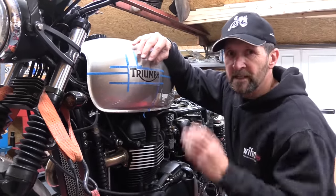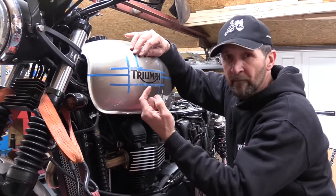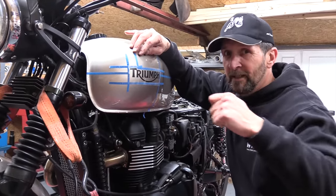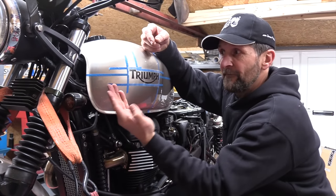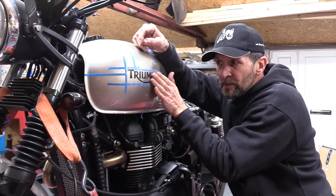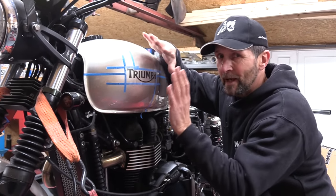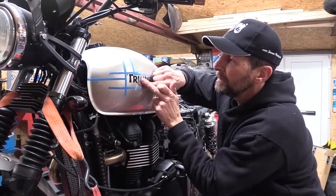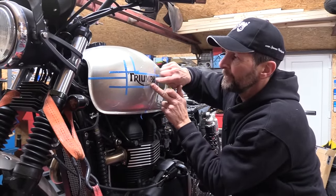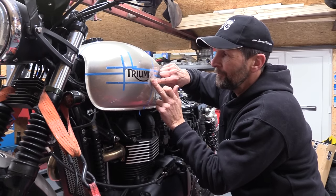Okay, at this point, an easy mistake to make is to take that cover film off and pull it that way. If you do that, it can pull the decal off the job. So instead, fold it back on itself and slide it along the job, and then it will leave the decals there guaranteed and won't cause any problems. There we are. Slide it off.